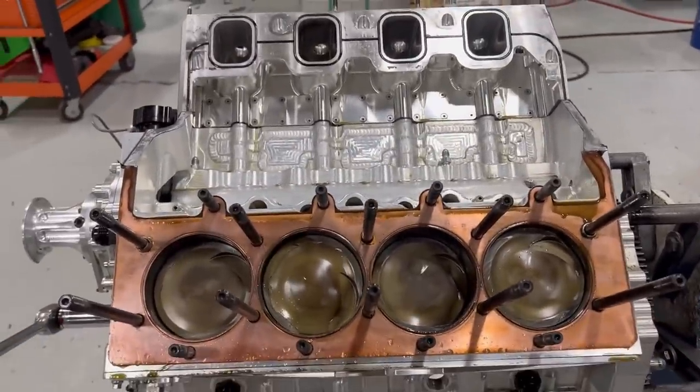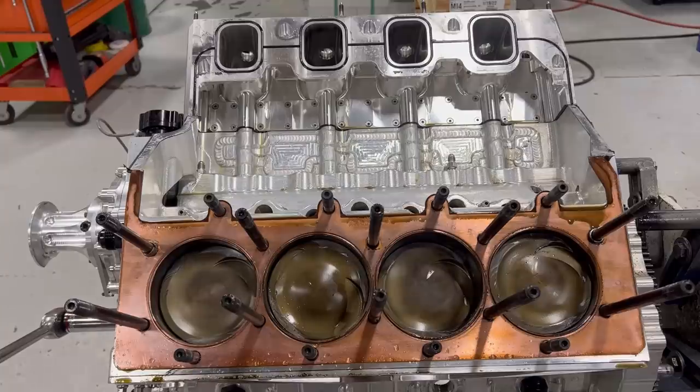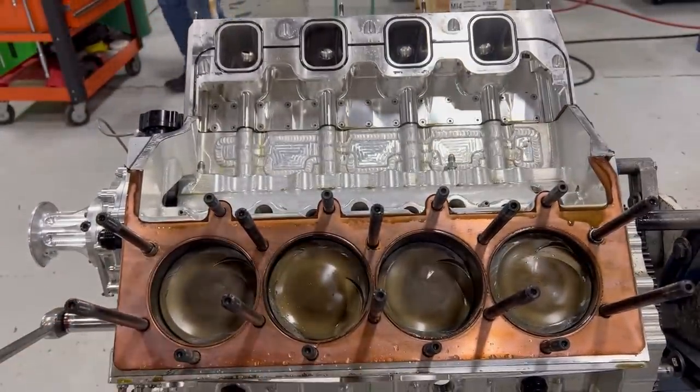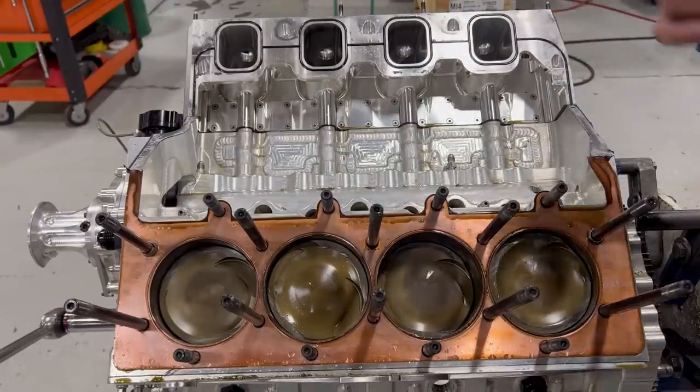Now I will have Alan jump under here and push up, grab a hammer or something, a handle, and we'll push the piston rod up. I think you need something longer than that. It's pretty far. I'll get this gasket out of the way. Gaskets look awesome, obviously, mainly because we're not leaning on this.